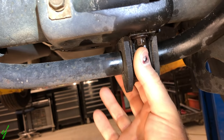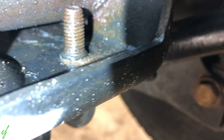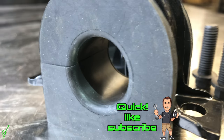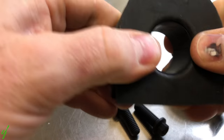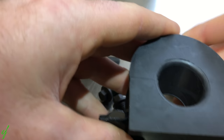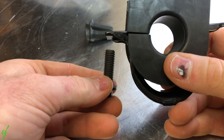So we're going to go ahead and replace this bar bushing on both sides. It looks like it's a strap and two bolts, where the bolt comes through all the way down here. I've lubed them up with a little bit of penetrating oil, and we're going to try to back those out and put some new ones on. This is the part number you're going to need — the only part number I could find unless you go directly through General Motors. You get two bolts per bushing, a bracket, and your bushing for each side. These are definitely harder than the ones that are on there right now. There's a slice right here, so all you got to do is take this bracket off, take your old ones off, slide this over the bar, slide your bracket on, and then put your bolts in just like that.